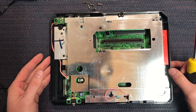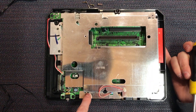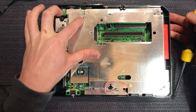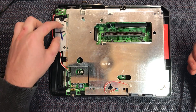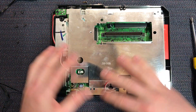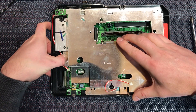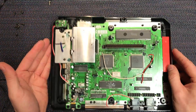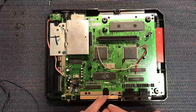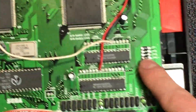Now let's keep digging - we've got to pull this shield out. All these screws hold the shield down: one, two, three, four, five, six, seven, eight, nine - leave the ones on the heavy heat shield piece intact for now. With those screws out, lift the shield, bend that little folded aluminium piece out of the way with your finger and the shield will lift out. This particular board is M5 PAL and the jumpers we're looking at modifying are over here.